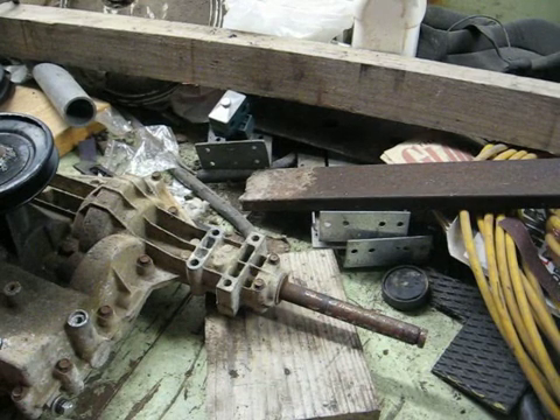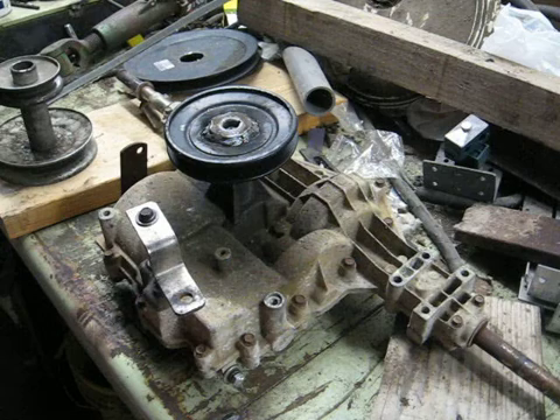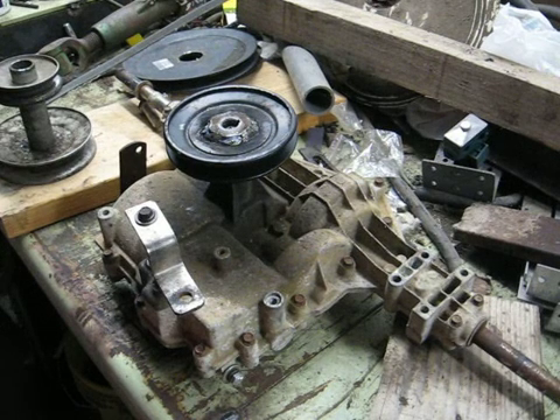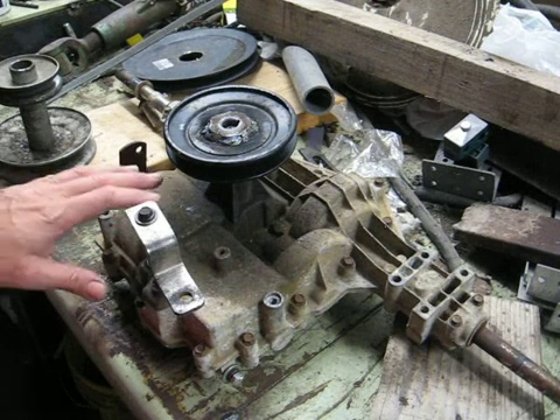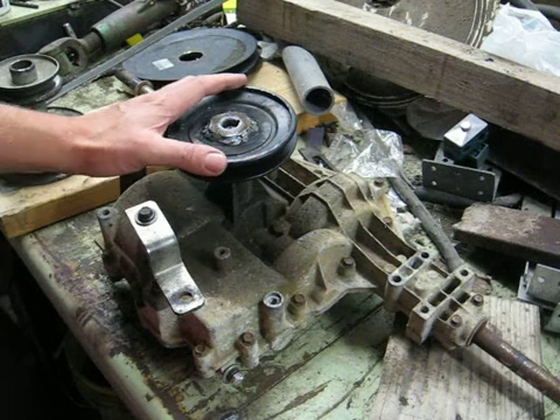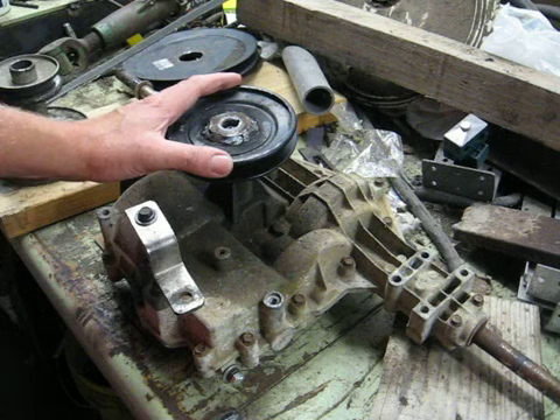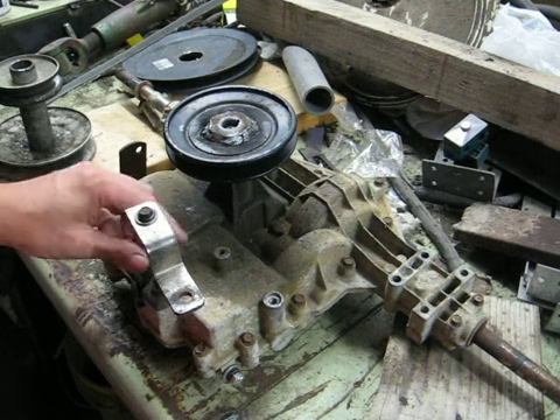I already put on a set of larger wheels — the Alpha GT, a larger garden tractor that has a little less backspacing. So they make the front end wheel track wider. I'd like the back to match. So this wide-body Murray transmission is going to go in my Craftsman. Both of these transmissions — this one and the one that came in the LTX — are Peerless MST205s. You can see the keyway there where it would need to drive.